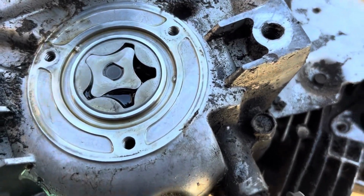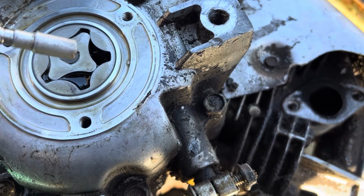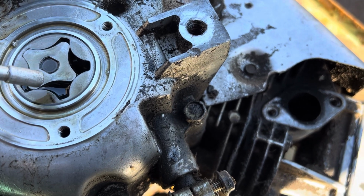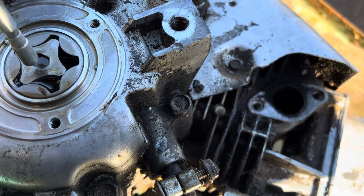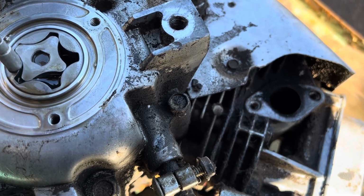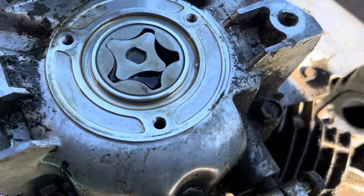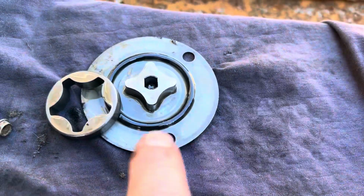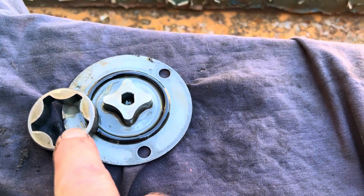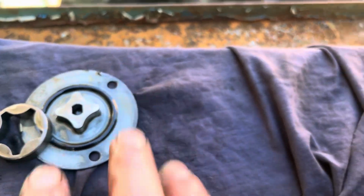Now there's your oil pump. What we're going to do, I believe if you pull this cover off, that drive, so the center of it right there, drops out. So you got to pull that out. So what we're going to do is we're going to take both these gears, maybe, hopefully, and pull them out. Might be a 2-handed operation. So anyway, that's my next step. So both removed. I left the side that I know is up, so I know which way it goes back in.